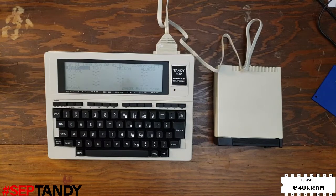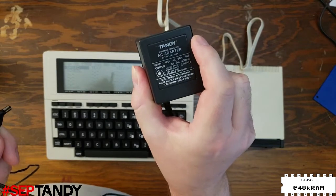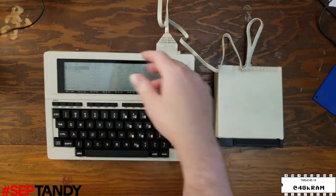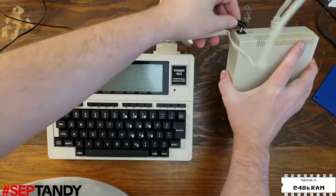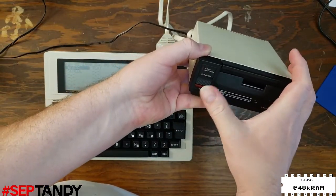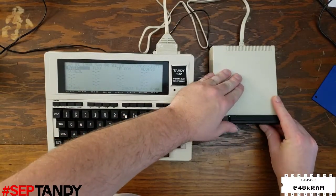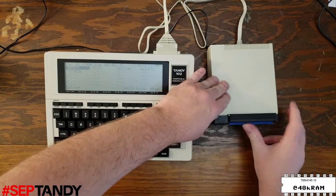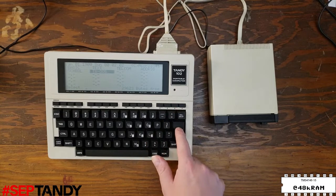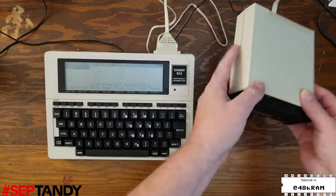And to power the drive, we're going to use one of the original Tandy 100 power supplies. It's voltage and pin and polarity compatible, so we can just plug it right in. I'm powering the laptop from AAs right now. So we'll put our mystery disk into the drive. And we're going to start up TS-DOS. I have that running from Rex on my computer. And we hit F4. And sure enough,